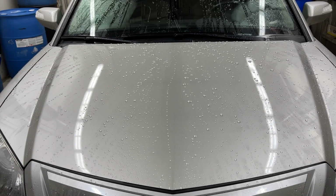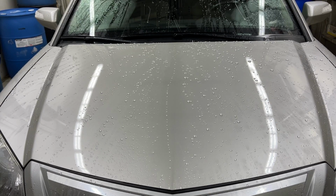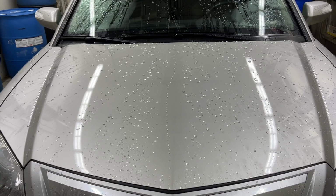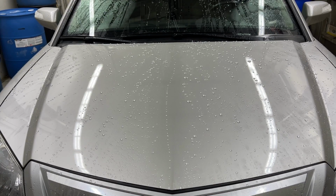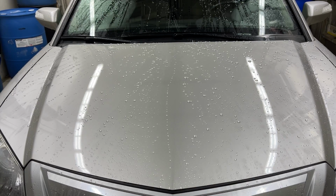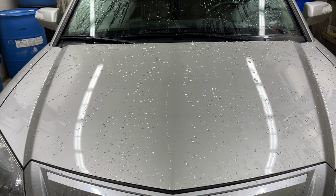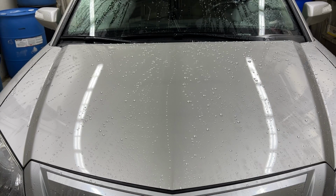It's not the cheapest product though. They got it, I think, for about $22 Canadian, but I've seen much worse. The Mothers Brazilian Carnauba cleaner wax was substantially less hydrophobic, and besides correction abilities, I think that's a really good starting point. I don't know how much better it's going to get with ceramic spray coating, because that's not exactly a bead monster either, but they are designed to play with one another, and it is designed to top it. So it'll be interesting to see how things change with 2 coats on the CMX and then the 2 coats on that guy, but we'll add that tonight, and then we'll recheck that water behavior the following morning.